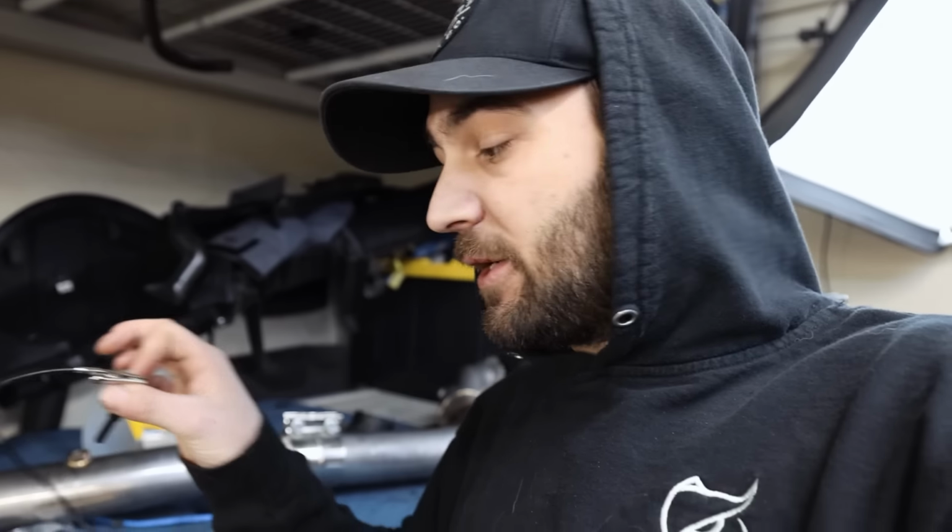So I'm gonna run a continuity test. If you don't know what that is, I'm gonna take my multimeter, stick one end into one wire on the connector for the throttle body. The other end I'm gonna back probe to verify that we have a continuous signal going through there. And if we have a signal, it's going to beep. So let me run this continuity test real quick. Hope to God that everything checks out fine and we'll go from there.